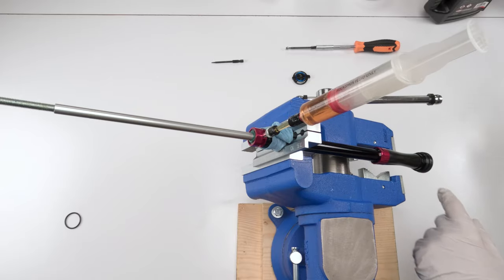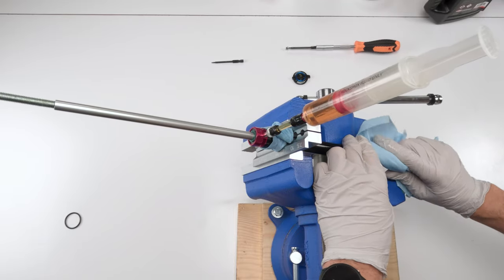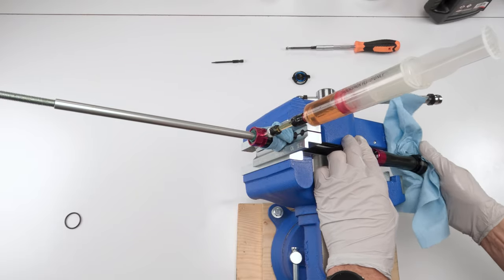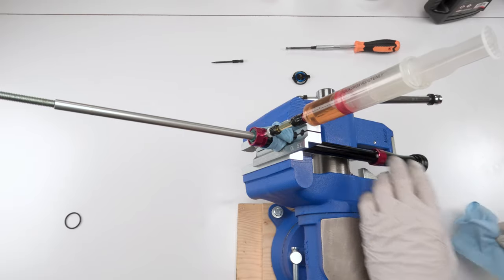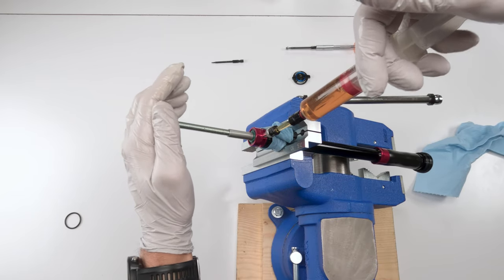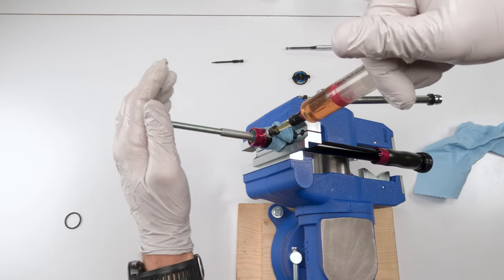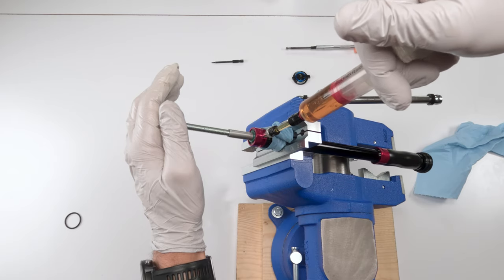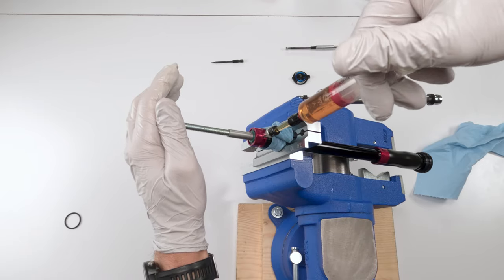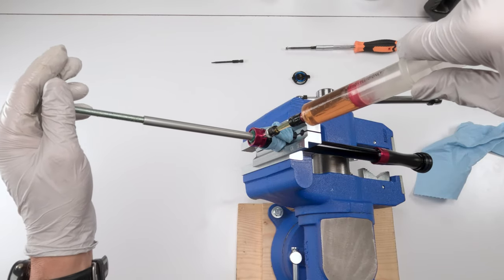Now this is a good time to check if you have any kind of leaks like I thought I might have had. So make sure you clean all film of oil or any signs of oil from your hands touching this, right? Apply pressure, bring this guy down, expand the bladder. If there was an oil leak, you would absolutely see it now, because this is the most amount of pressure that that bladder will see. Even when riding, it won't see pressure like that, nowhere near that kind of pressure. And I see zero leaks, so that top part's good. All right, and we just keep on going back and forth.